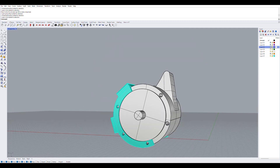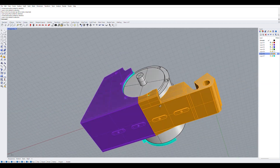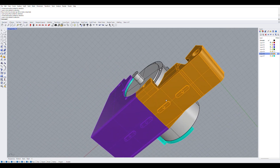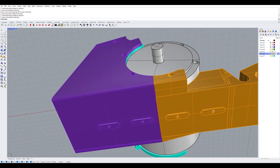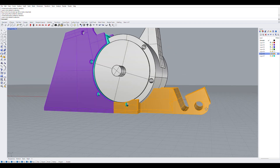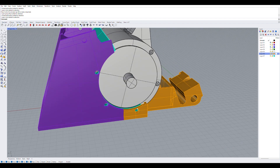For the next step, which is the battery mount — we are no longer going to have the battery on top near the gas tank, as the controller is too big and I need to store the controller in there. Instead, we're going to have the battery underneath. What I've created is four sockets where the battery mount itself goes for hooking up the battery. The bolts will go through to mount that part of it and then the battery will just slide onto it. In the back, we have the hole where the bar goes through for the rear brake and also for the new foot pegs.